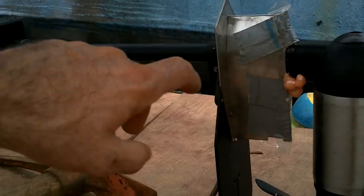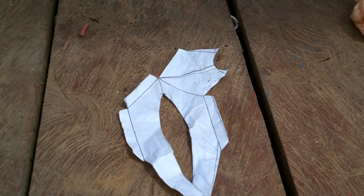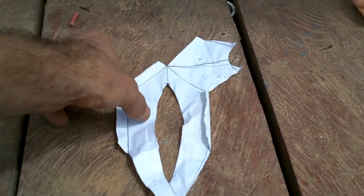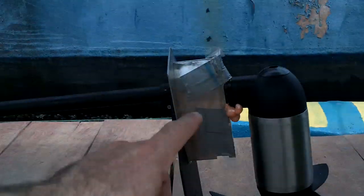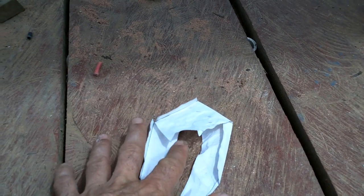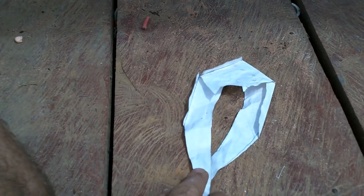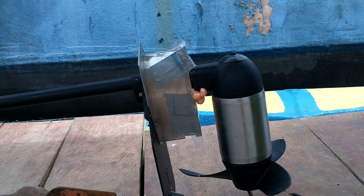I should be able to go faster without getting bubbles down at the propeller too. I also made it so I can put the motor a little lower in the water than when I was testing before. This top metal piece — I made a paper one first, then these two pieces fold over to give nice edges, this folds over, this folds over to hold it all together. The bottom piece comes up and has little flanges that overlap and get squished in, and the screws go through some of the flanges too. I put it together in the dark last night so I didn't get any video of it.